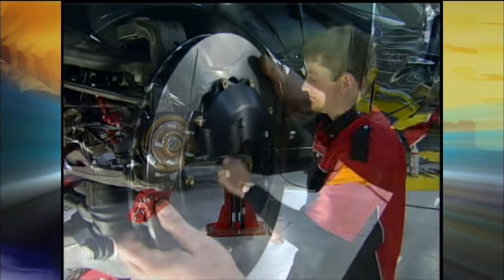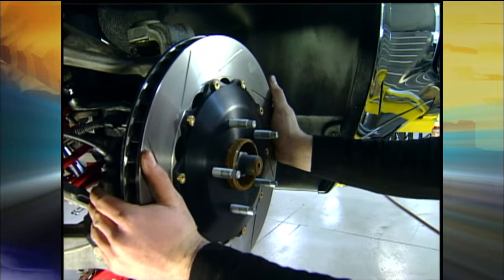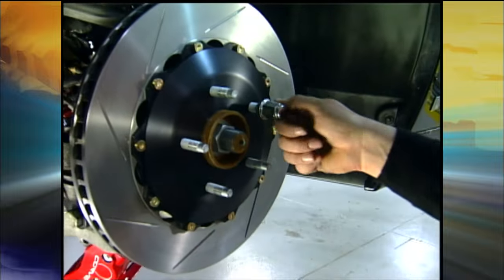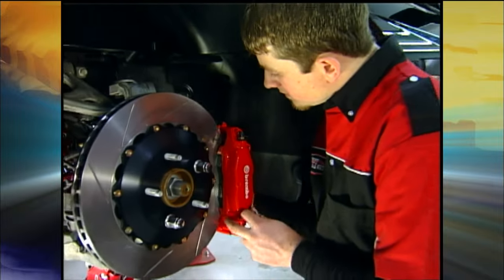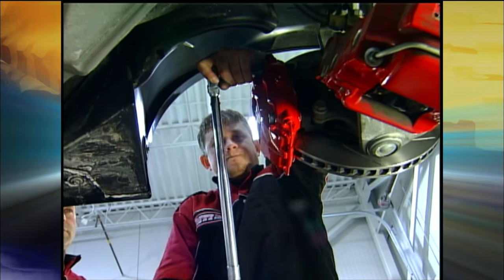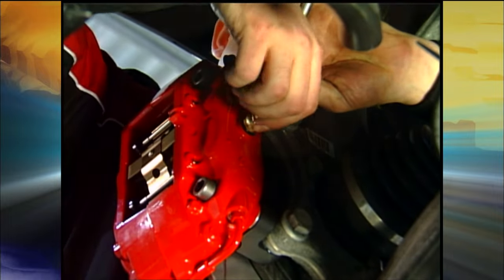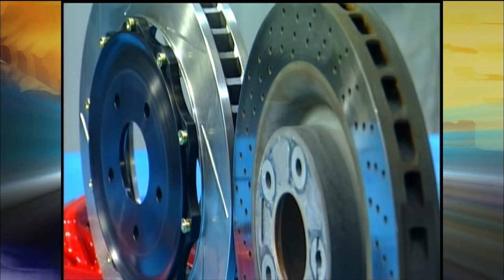Even with a high-caliber system like Brembo, we still look at critical areas like rotor contact — is the rotor spaced equidistant from center so the pad and rotor won't contact the inside of the caliper? That attention to detail is why you'd want a professional to install your brakes. With a multiple piston arrangement — six pistons — something has to give. GM used six individual padlets, but Brembo has gone to a big beefy pad with a two-piece rotor using a pin and bobbin drive for the floating arrangement, eliminating any bind.